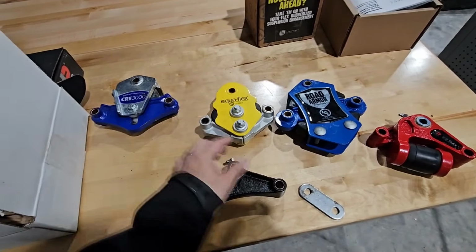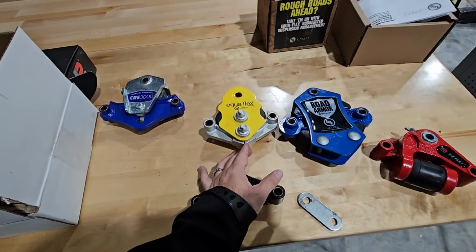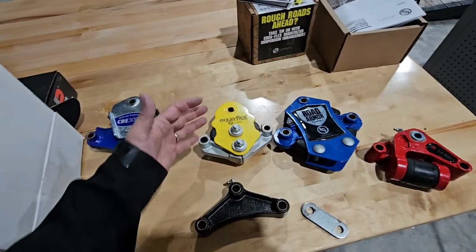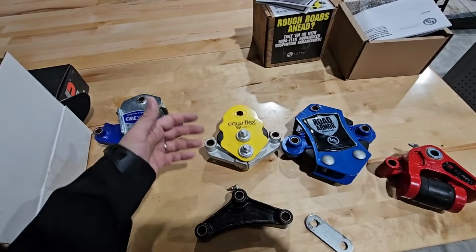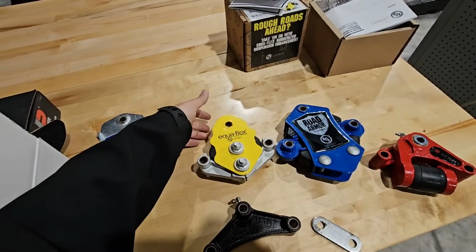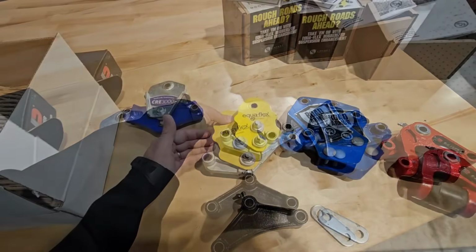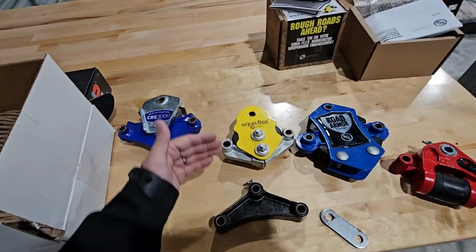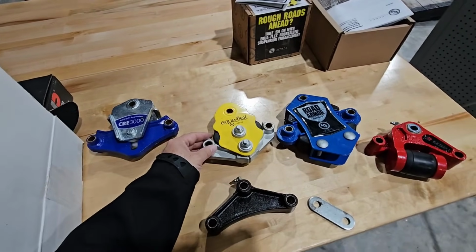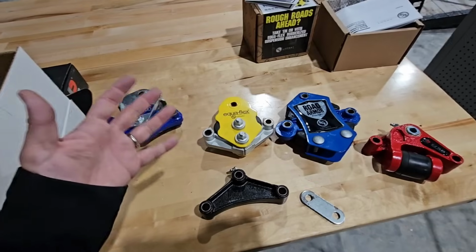The minute you put some weight on here, there's probably going to be a gap that forms right here because of that weight, which means if one axle is moving, yes, everything is technically tied together because it's an equalizer, and you have one single point as a fail, and you have one single hanging point here in the center. Each axle and leaf spring has its own capability to pivot its corresponding side of this equalizer because of this pivot point. It's just super cool.